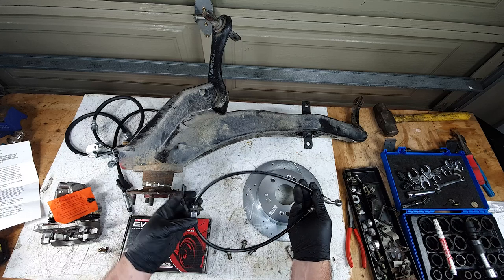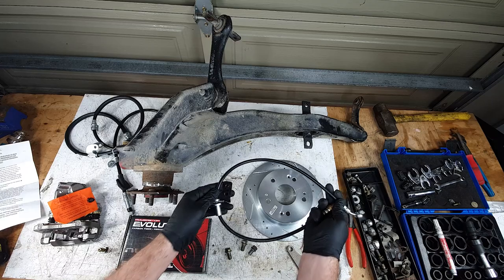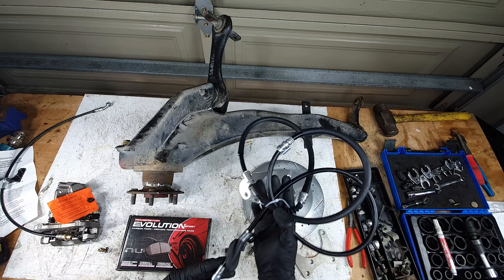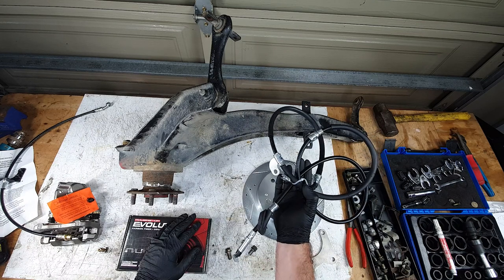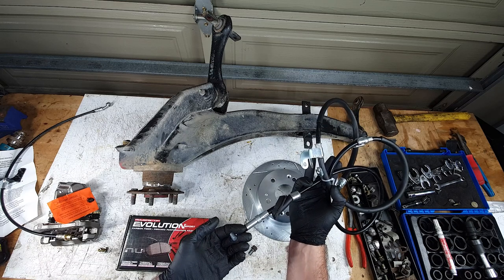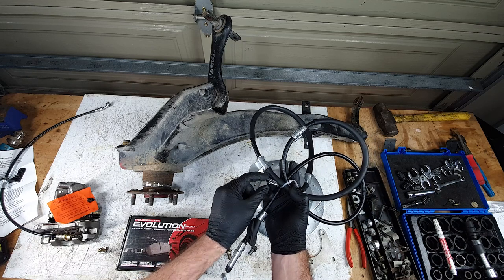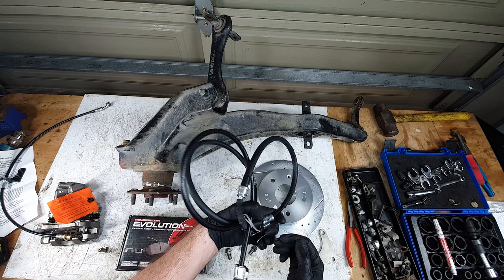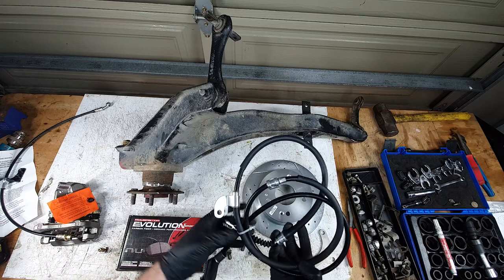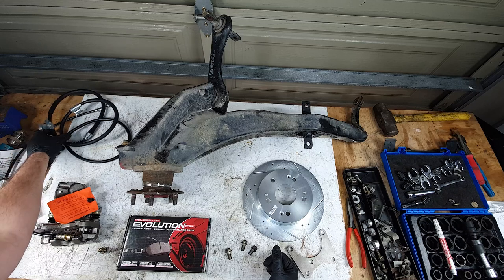So we're gonna run it a little bit differently to what you may have seen online in different forums and videos. So yeah, you're gonna need 94 to 97 Honda Accord disc brake cables. It's got the same handbrake mechanism as the CRV, and it's got the right end for Prelude calipers. I got this from Rock Auto, and it was fairly inexpensive. I will have a full parts list, everything, in the description of this video.